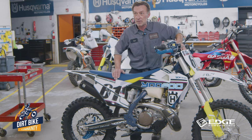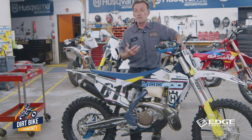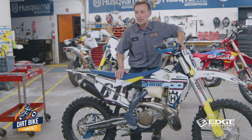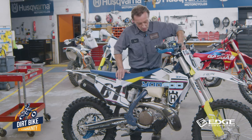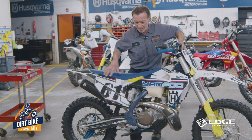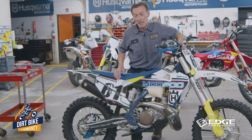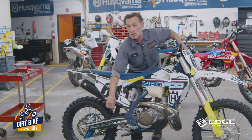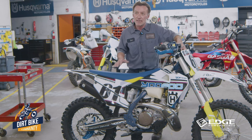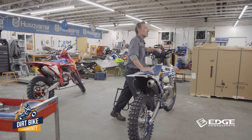Your bike is set up pretty nicely — it's coming up even and compressing evenly too, so I'd just tweak from there. That's actually something I still need to do on my supermoto bike. I've got a big buddy who does the compression on my bike while I stand back and get a good visual on it — sometimes you can look out in your peripheral and see how the bike is coming up. From there you can decide whether to speed the rebound up or slow it down on the back or front end, and that gets things balanced before you head out to ride.